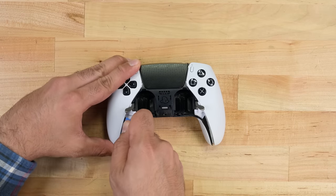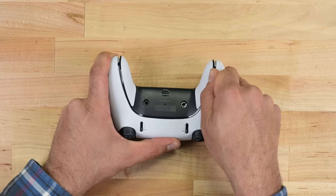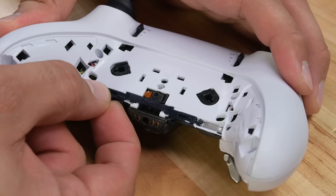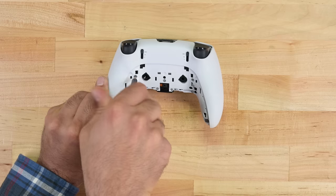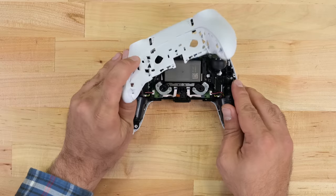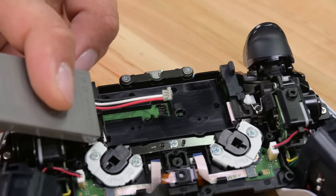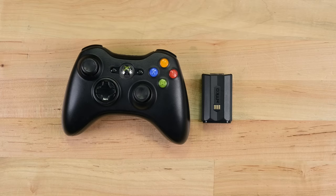Going back to the controller, we're looking for the next most common repair: the battery. This part requires an easy but nerve-wracking declipping of the controller covers. These clips are known to break and they're locked in place pretty tight. The clips on the DualSense Edge feel a little easier to pry away than those on the standard DualSense, but honestly breaking a clip or two wouldn't be the end of the world either. A few screws later and hey presto, we've got the cover off. The battery lifts up easily and gets unplugged, so DIY battery replacements are possible. Not as easy as it could be, but at least we don't need to disassemble the whole controller.